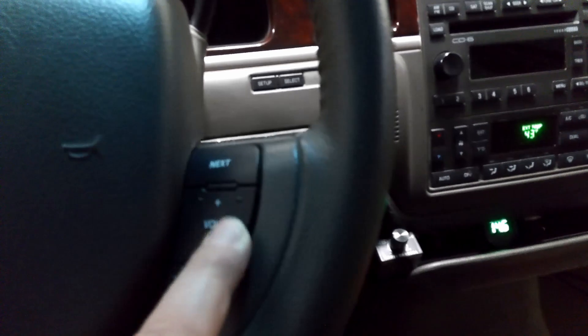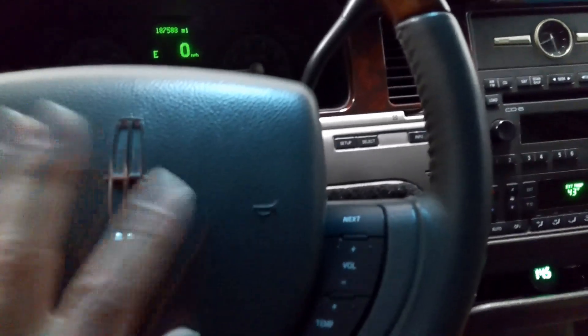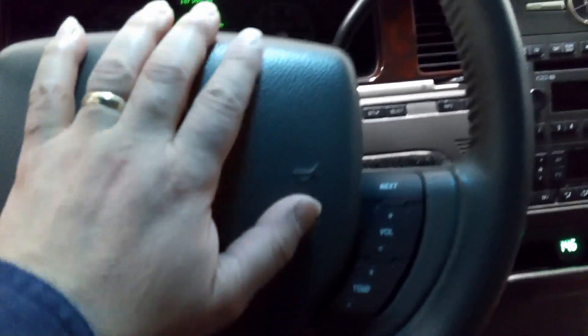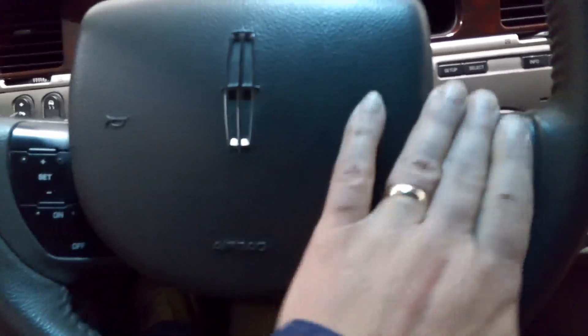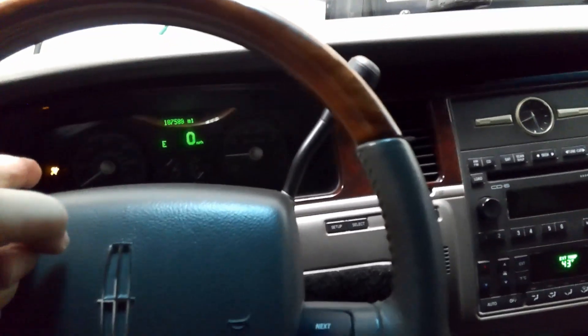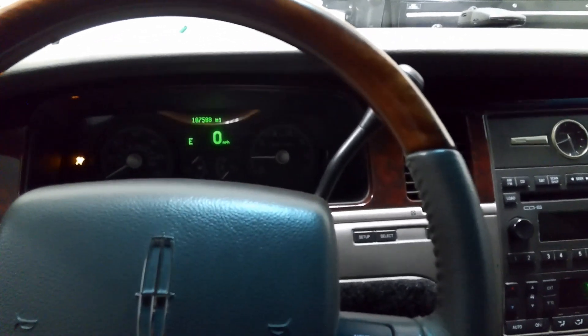Also, I'm going to get this looked at. I put it in — I installed it, it's a new one. But still, it's not working. I'm not getting any volume, it's not doing nothing. I already took it to the dealer last week and they told me it's the ground — even though the horn still works and the cruise control still works. It's just this right here — it's the ground, so it's the clock spring. And the airbag is notifying that the two front sensors from the front of the car, those are going bad.